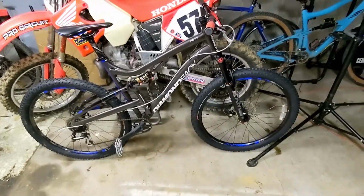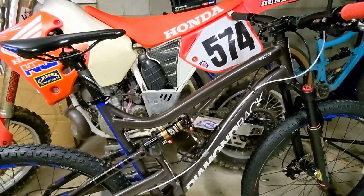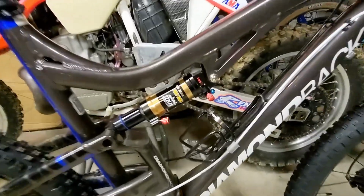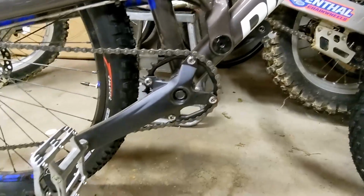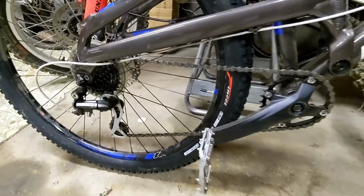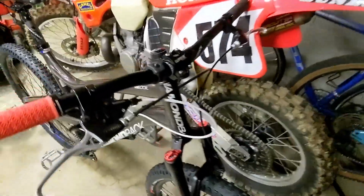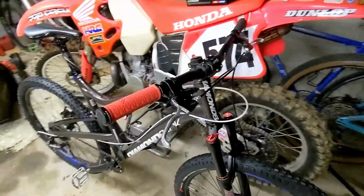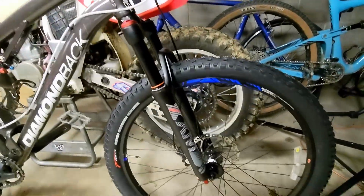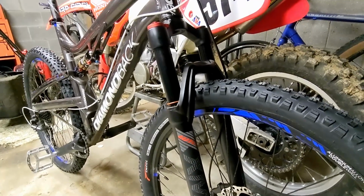So this is the build. I'm hopefully going to take it and ride it tomorrow out at Turkey Run for a little bit, but just to kind of go over everything we've done to it. So we put on that D&M air shock, we took off a super heavy coil, and we have put on a 1x8 drivetrain, stock derailleur that came on the bike, just this square tapered 1x setup. And if we come to the front, well, we got a new shorter stem. Unfortunately, still got the kind of narrow bars, which maybe could be updated to something like a 760 or 780. I think it's only about 680 right now.